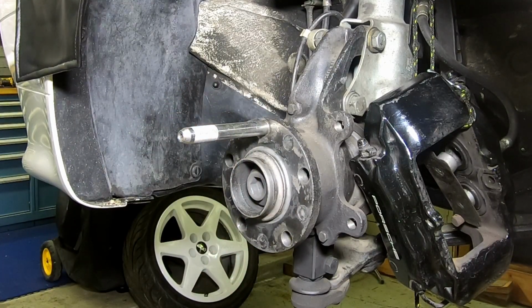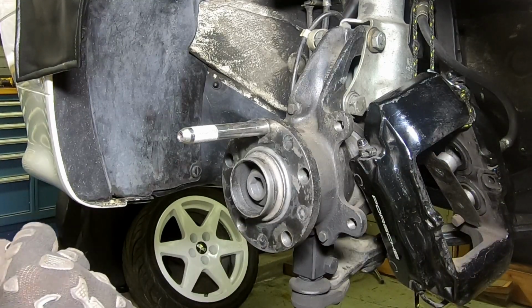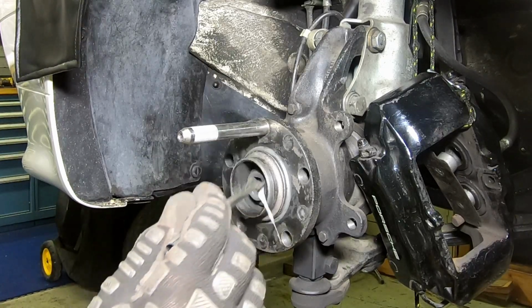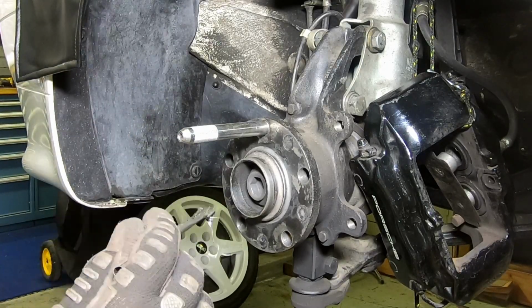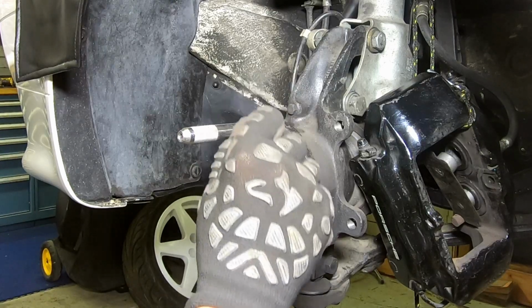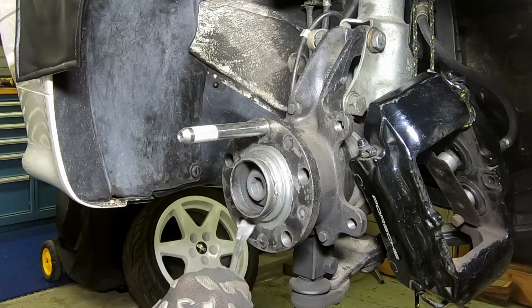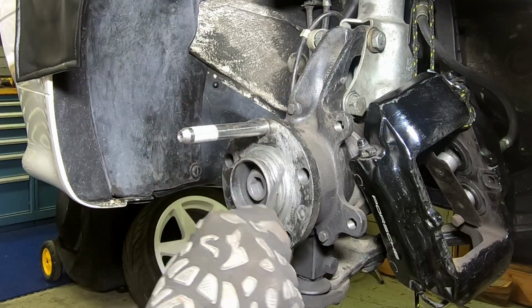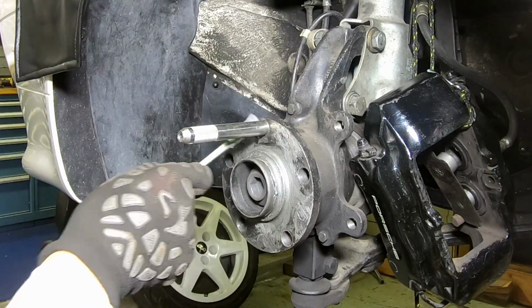If you want to find out more about these wheel hangers, there's a video on that. So what I do is I take my anti-seize. In this case, it's Loctite, the nickel. You got to remember that the rotor on a car probably gets hotter than anything else in the car. Even if you're running a turbo, the rotor gets hot. So what you want to do is you don't need a whole lot. You just run it around here. Now, I have a tendency to put it on lightly on the hub itself because I figure it can't hurt.